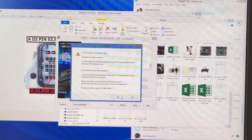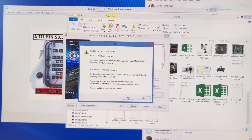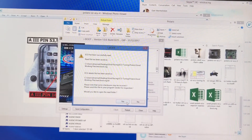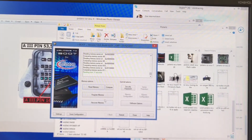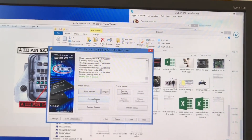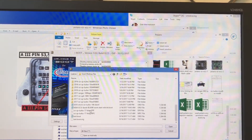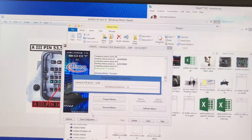You can then open this up in your editor, make your changes, and once done you can flash through the iFlash. If you want to flash right back to the ECU and you have a file ready, you don't need to put it in boot mode again because it's still in there — unless it's been a while and you've turned off your power supply. You can click program, choose your processor, hit OK, and select your file whether stock or tuned, and you can program that file back.